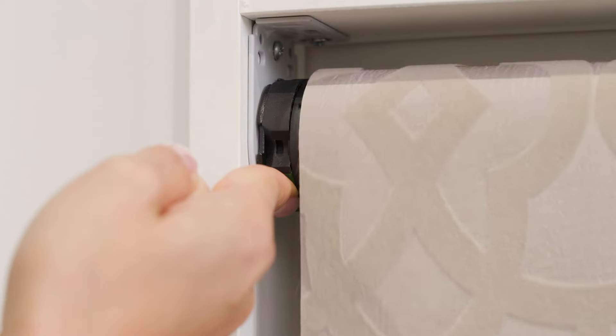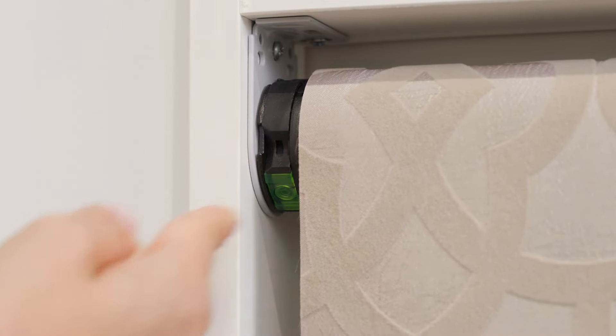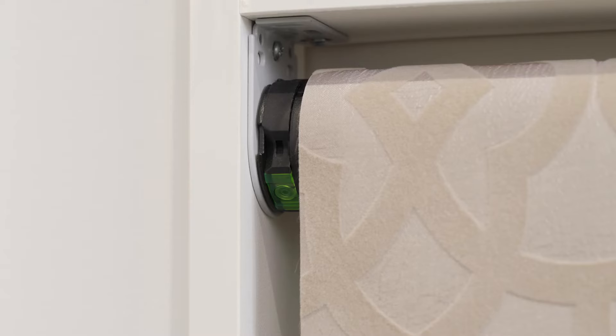During this 14 second period, the blind will jog four times, with a lengthy pause between jogs. After the fourth jog, release the P1 button. The blind will respond with a series of jogs and beeps, now indicating that the blind is back to factory settings mode.